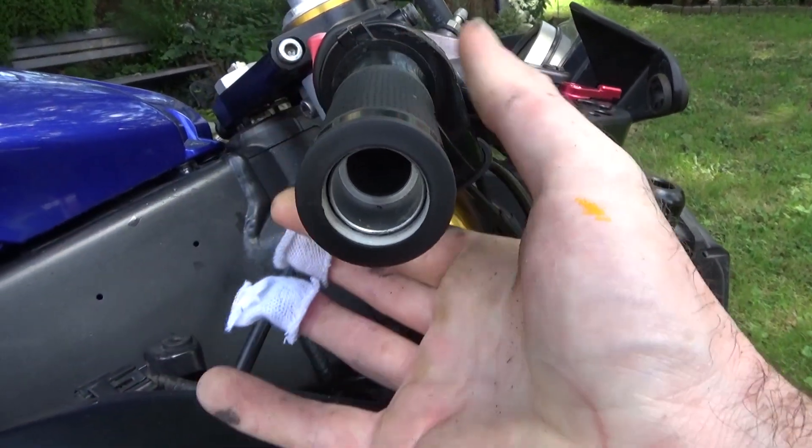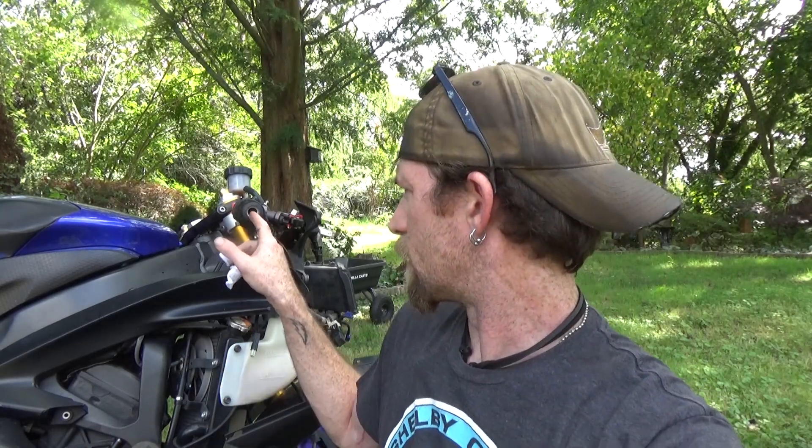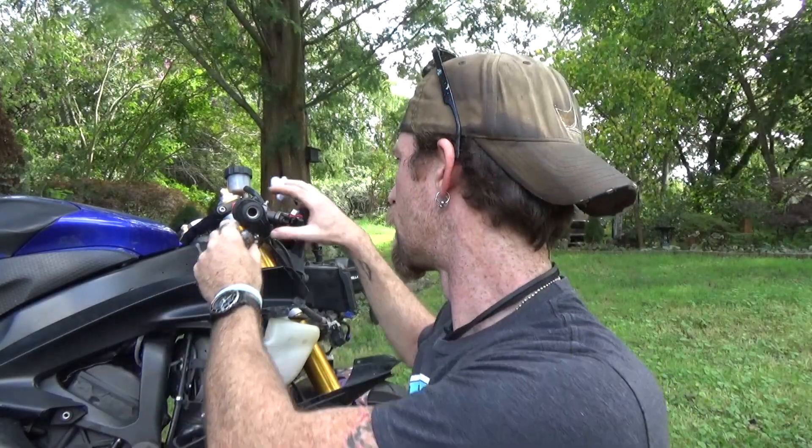Nice - and you can see much, much better. If they're any type of good quality you don't need to put glue on the grips - they should just hold fast. I'm also going to put these bar ends on - just a little bit of an accent. I want to see how the bike rides and whether I want a weighted bar end - I'm not entirely sure yet since I haven't ridden this bike. They're pretty simple: they've got a rubber piece, you tighten down the nut using the hex key bolt until it's snug, then tighten it down more. Position the R6 logo where you want it. Keep in mind there are two, and because they both say R6, pay attention to which side each one goes on or you'll look silly.